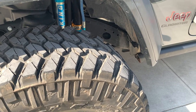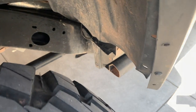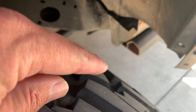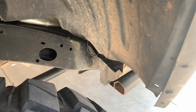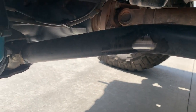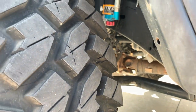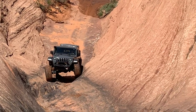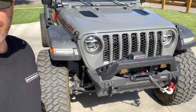Let me show you what we had to do to make these tires fit. First thing we did was cut the factory rock rail back a little bit, and we trimmed these fenders up quite a bit — they're still stock fenders, I like the look of those. It's also rubbing a little on the lower control arm, which is not a big deal. Overall it does really good — at full flex we do get a little rubbing on the fenders when it's full lock.